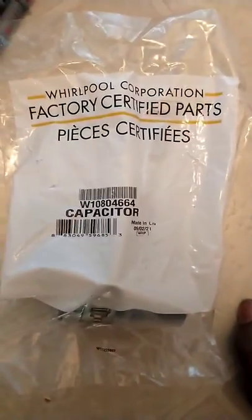So we ordered the capacitor. It's the part number. I'm gonna put the link in the description where you can get it. But that's the part number. The one on the washer is black. This one is silver. But it still works because all that matters is this is a 50 UF plus or minus 5%. All right, take out the capacitor just so you can see where it's supposed to be.